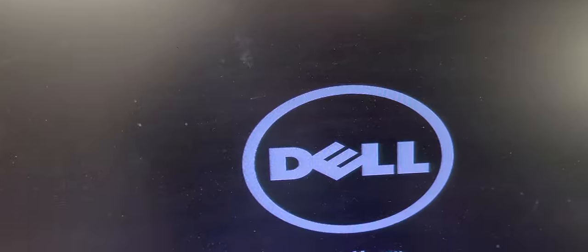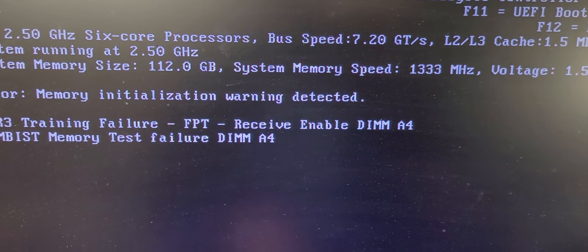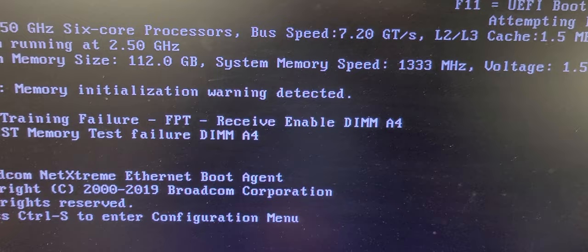Well, the answer to that is, remember that inside this particular 720 chassis resides a principal component. Now that component is basically the function that exists out there, and it is going to give you the capacity to post what we call a dual SSD configuration. Now the two flash cards, that's high performance SSD series Oracle, I think they're 400s. They each have 400 gigs on them for 100 gig allocations each. And you can configure them in different formats that you want to do. Now with that, these are PCIe cards.